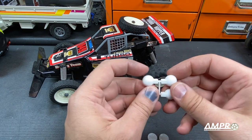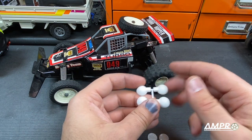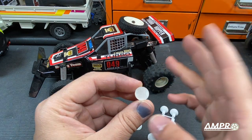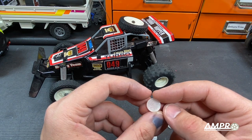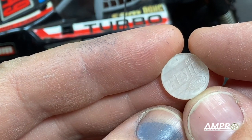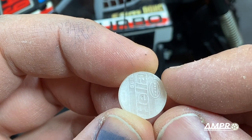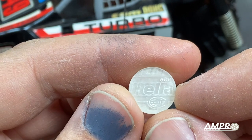These main housings here, you'll spray paint in whatever color you'd like. Factory would be in black, but we're gonna make this a little bit more fun, and I'm gonna paint these in chrome. I use a Rust-Oleum chrome paint that looks fantastic. These will remain white. And what I want to mention prior to actually painting: these are made in the ultra detail plastic from Shapeways, and there are cases where some of the support material that was used on these can be left over. So if you find it has kind of a waxy feel, I would highly recommend taking a small brush, some soap and water, and giving it a good scrub, allowing it to air dry, and then go ahead and primer these.